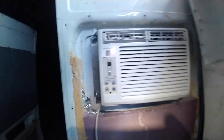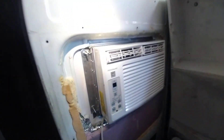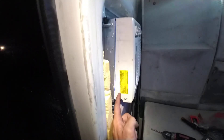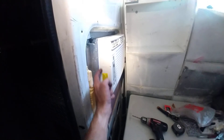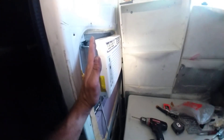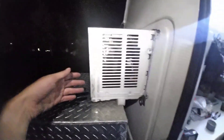Here's the prototype fit of my 5000 BTU window AC in my Sprinter van. I've riveted on these aluminum angles — this is the final result. I got the angle just right: you'll see that this is a straight up-and-down line and this is a line angled that way, giving just a very slight downwards angle so that the water can get to the fan, which makes it more efficient and also prevents it from pooling up and molding.